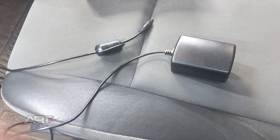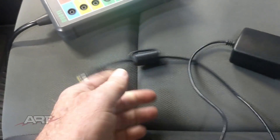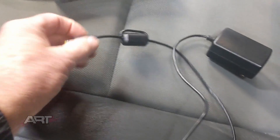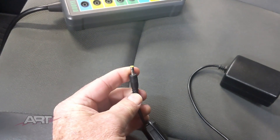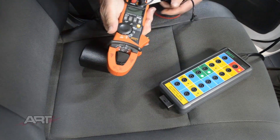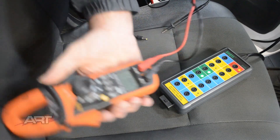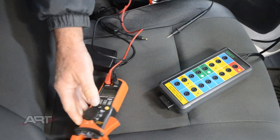Normally you wouldn't have to open the door while you're changing out a battery, but if you did, the 2 amps might still power the interior lights. So let's go about hooking up to our breakout box. First, you would want to be able to determine for your power supply which was positive and which was negative. One way we can do that is with a typical meter, set to volts.